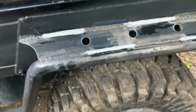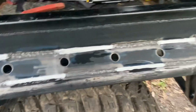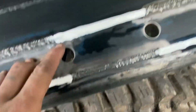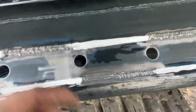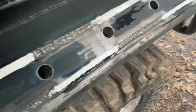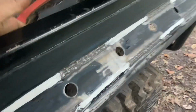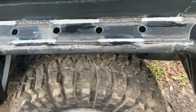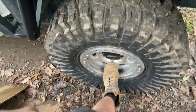So that's all put on and spread where I want it. But yeah, you can just see it fills that edge. So it continues the thickness of the weld through, finishing it so there's no open edges. But I don't think you can sand this that well. So as I was saying, you've got to do it good the first time, because you'll see it under paint. It's more of a seam sealer than a finished surface thing. I'll show you the thing.